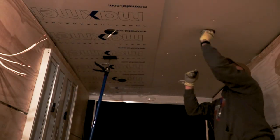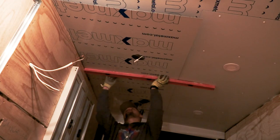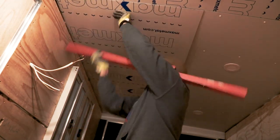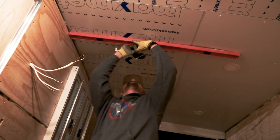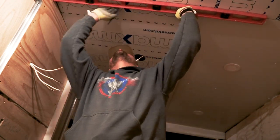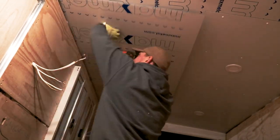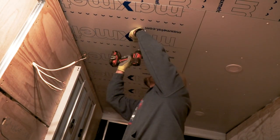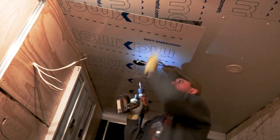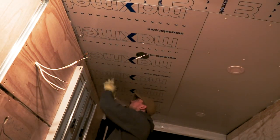To finish up that side of the trailer, I went ahead and finished the wiring of my light and put that puck light in. Then on the other side I marked where all my screw holes will be. I like to evenly space all the screws so that when you're looking down the length of the trailer everything is lined up and looks professionally done. I went ahead and anchored a couple screws to the ceiling joist since I didn't have another support panel, and then pre-drilled the rest of my holes.